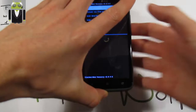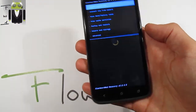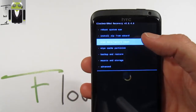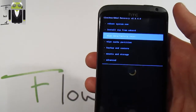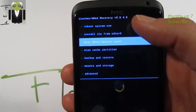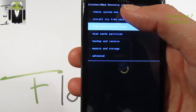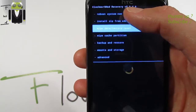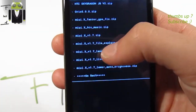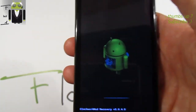Hi, this is Flo, and today I want to show you on the HTC One X how to flash Oreo and the different modes available on the Aroma installer. You already have flashed the boot.img from the zip with fastboot USB using the command 'fastboot flash boot boot.img'. Now you have to go and install the zip from SD card and select your ROM from the Oreo last version, and install Oreo.